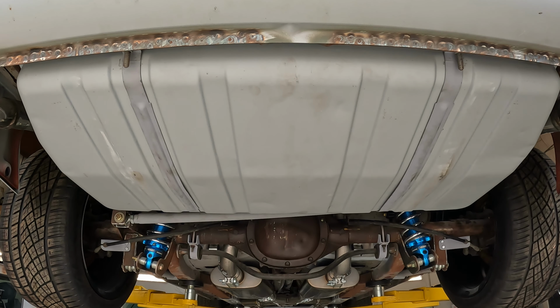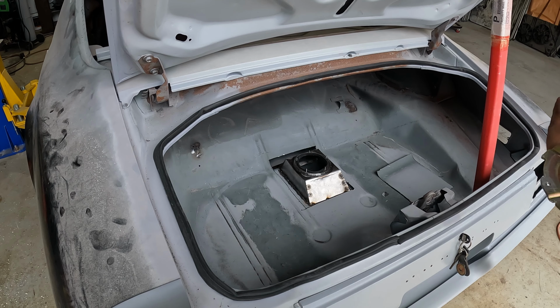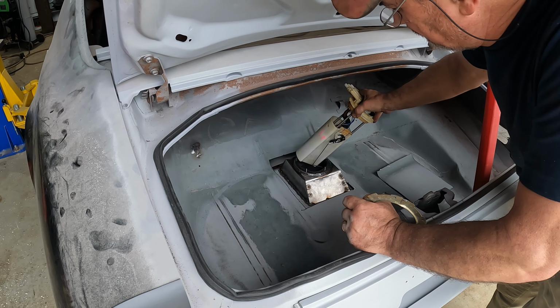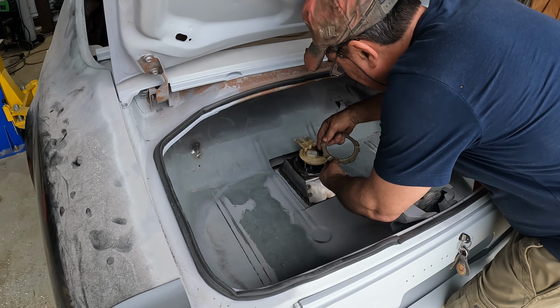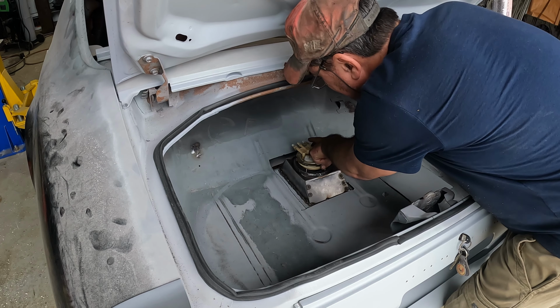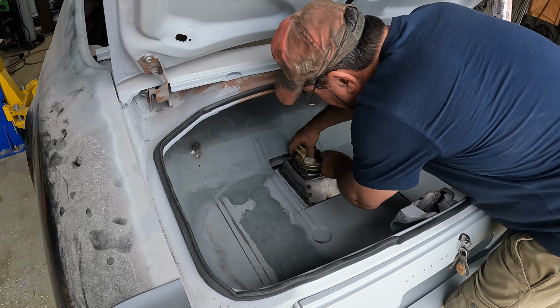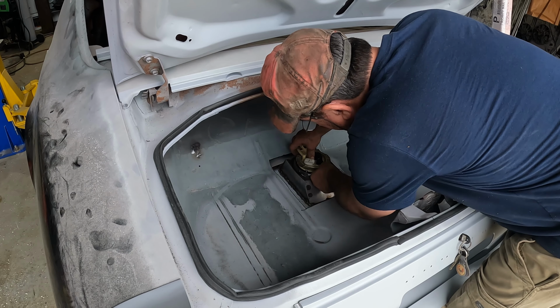All right, let's take a look and see where the next move is to cover that fuel pump housing. How's that? I've got the tank tightened and in position. Let's do a quick test fit of the fuel pump housing and see how it fits. So we'll just slide it in, get my locking ring, which goes this way, compressor down. Now I probably am going to have to clock the fuel pump itself. There we go.